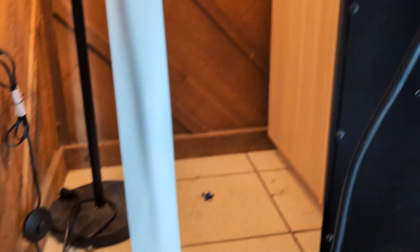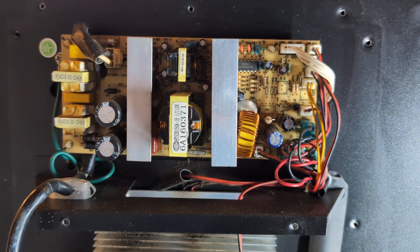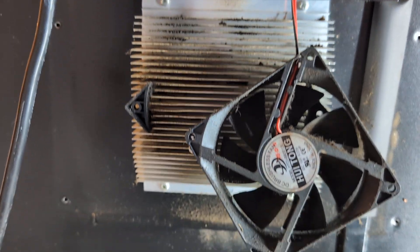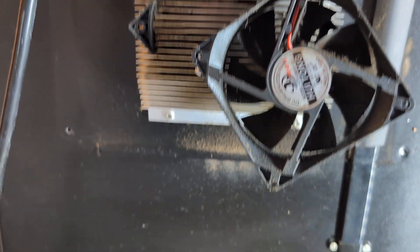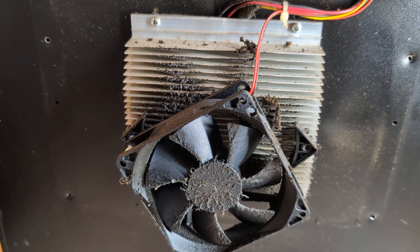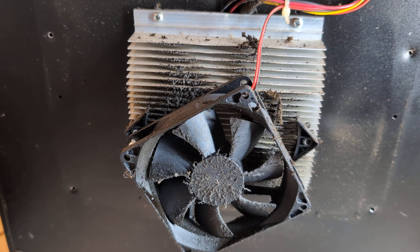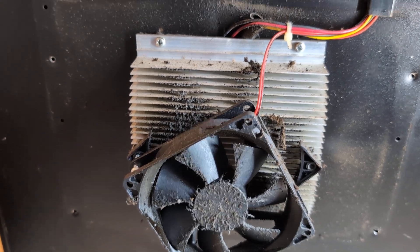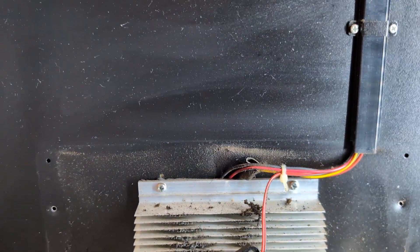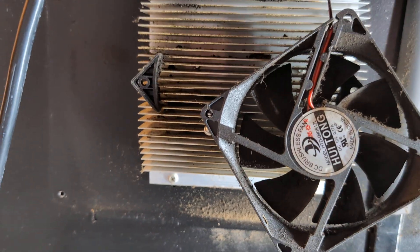When I took off the covers, I discovered that this system consists of a circuit board — a solid-state circuit board that controls everything — and two coils. I'm going to call the thermoelectric devices 'coils' — they're heat sinks. These heat sinks work by moving heat from inside the refrigerator to the outside, and then rely on the coils and fans to move that heat out into the air.